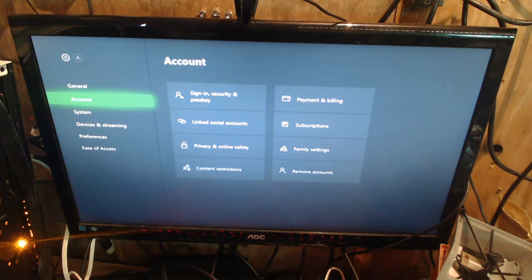So just to summarize, the green screen of death, as it's known, is caused purely by a faulty hard drive 90% of the time. Sometimes it can be related to some hardware on the board or related to the cable, but most of the time it's going to be caused by the hard drive itself because of the amount of time these consoles spend switched on. So we resolve that by simply swapping out the hard drive for a good drive and reinstalling the software using OSU1.